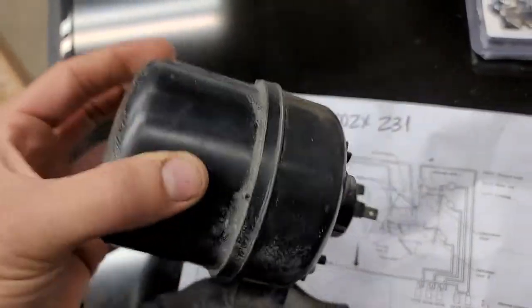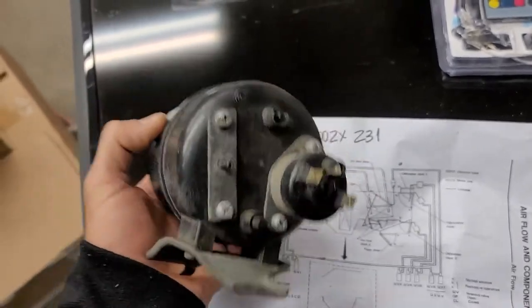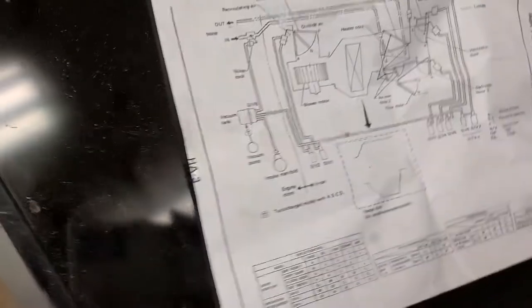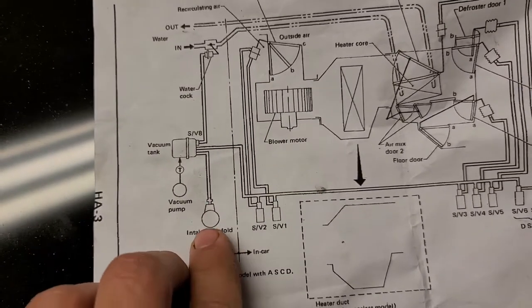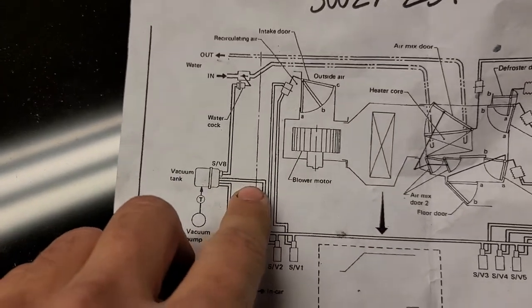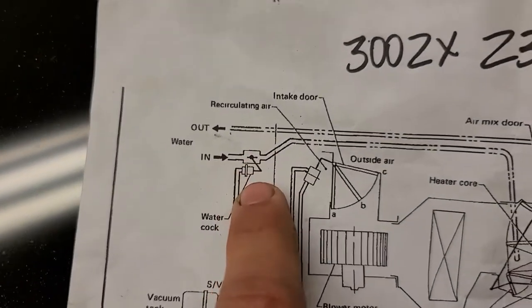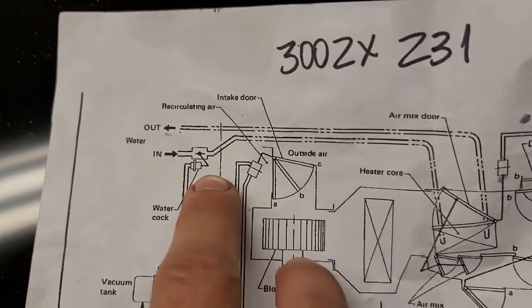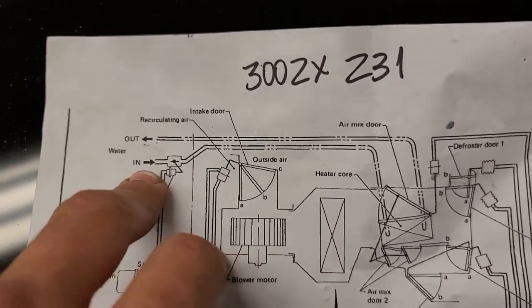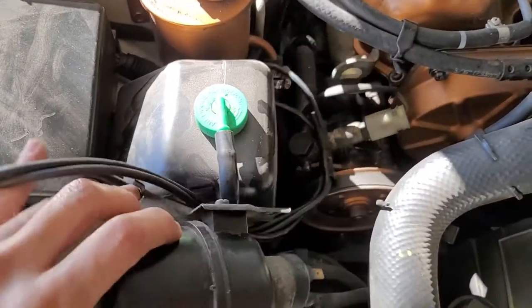Because this guy went bad and it looks ugly — I don't really like how it looks in the car — and it's taking up space, I'm going to remove it. What I did is very simple. I'll be showing you in the car. I bypassed the hose that goes to the intake manifold into this one, bypassed the one going inside the car with the manifold, and deleted the whole system. Also, this valve — I want to have it closed all the time because I don't want coolant going inside the heater core. Here in Florida it's very hot all the time, so all I need is AC.